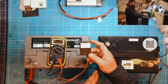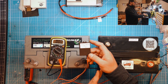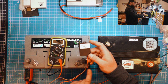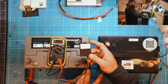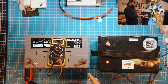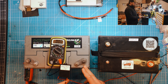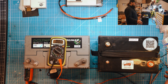To explain how the Battery Master actually works: it works on a difference in voltage between the two batteries. As soon as your leisure battery is 0.75 of a volt higher than your engine battery, it will trickle charge your engine battery from your leisure battery. If the difference isn't big enough, it won't charge. Currently we have 12.8 volts and 13.2 volts — the difference is not more than 0.75 of a volt, so if I connected this right now it wouldn't actually charge the engine battery.